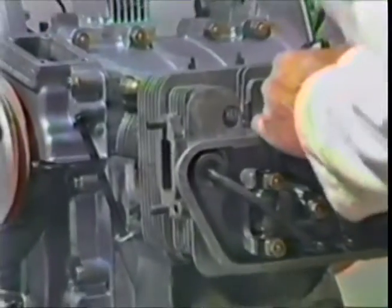Okay, get the number 2 cylinder done. Crank the engine counterclockwise again until this time the OT mark comes up and aligns with the notch in the 3rd piece. You can rotate the engine stand and then go off and do number 3.